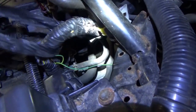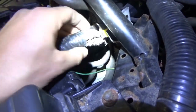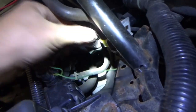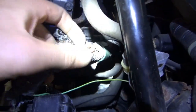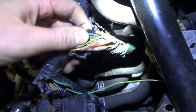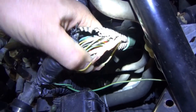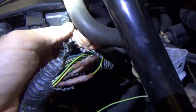That wire was apparently — oh, this is sweet. I love it. It's a good thing we went for the root cause instead of doing a bypass wire, because there are other issues here. Look at that — here's your problem: butt connectors. So somehow this harness was damaged in the past, and we have one, two, three, four — even five wires there that are broken. And the one we pulled out was, in fact, the ground for APP sensor B.